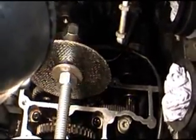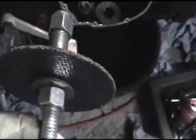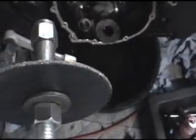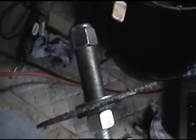So little by little, as it's spinning, you push it into the wall, and this disc here was measured to be the perfect diameter, the same as the sprag clutch, the larger one, obviously. I think I made it a millimeter bigger, and so as it's spinning, it's little by little just grinding away at that wall, and so that's why I mentioned it makes a mess inside the engine. So what you have to do is cover everything, set up a vacuum, or pull the pan out from underneath, but then you gotta really wash the engine out or split it.